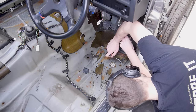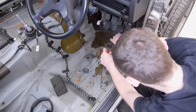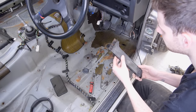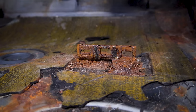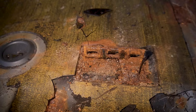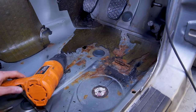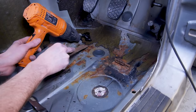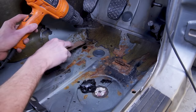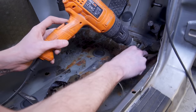The pedal is removed by prying open two clips on the front and one at the back in the middle — once you get one loose, the rest follow if you keep upward tension on the pedal. The mounting bracket is definitely too crusty, and with them being so cheap to replace it's a no-brainer. A heat gun is your best friend for removing the more stubborn soundproofing — just a few seconds and it turns into a play-doh-like substance and comes right off.